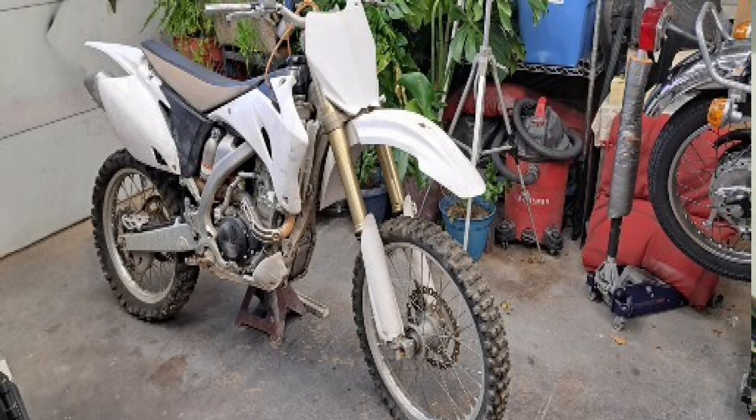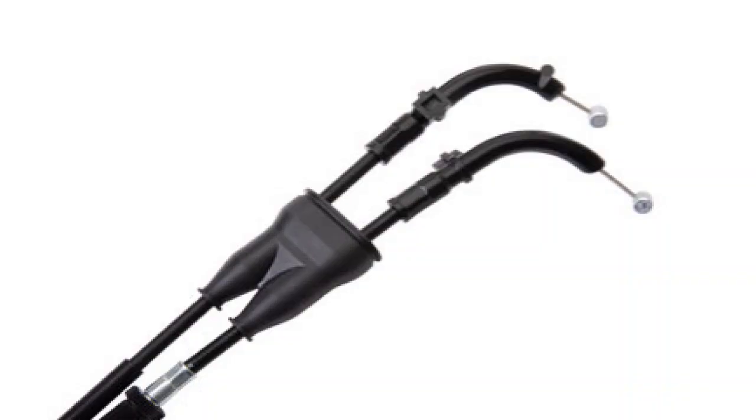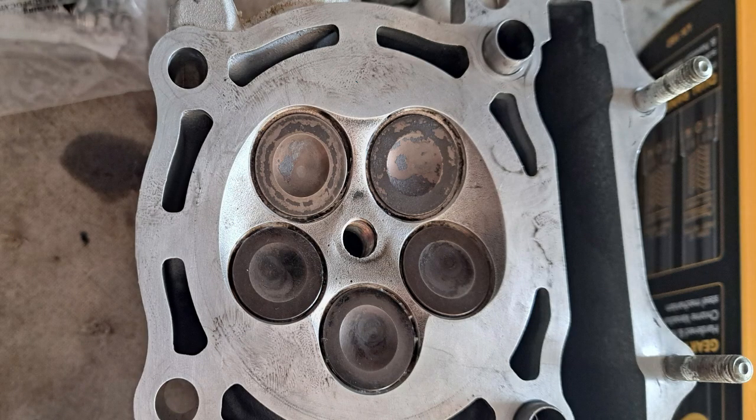The plastics were trash — they looked better in the pictures than what they actually were, so all that had to go. The seat was trash; my dear wife recovered it and it turned out very nice — she put a lot of effort into it and it looks great. Cables were missing, front brake caliper missing, chain missing, sprockets were shot. So we put a clutch in, a timing chain, piston rings, thoroughly inspected it, put it all back together, and we're pretty happy with ourselves. But we go to start it and it's got a bad noise — I'm gonna play that clip right now.